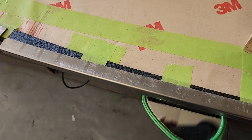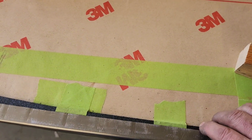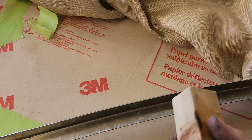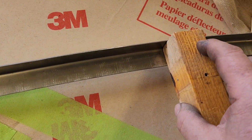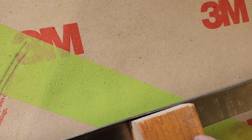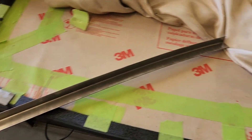You can see this edge has worked off a little, so I have to pull that in. As you shrink and stretch, sometimes it'll open up - this was bent to 90 degrees initially but it'll move. So I'm using a 90-degree piece of wood with a relief bevel on the bottom that fits neatly in here, and I double-check to make sure it maintains square along this edge. I have to put it in the vise and keep tapping it down. I want this whole thing to stay uniform as I fit it to the rim - we don't want it wiggly and require a lot of Bondo if we can help it.